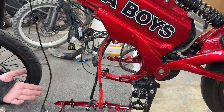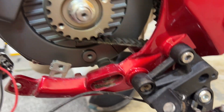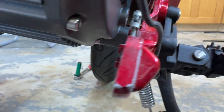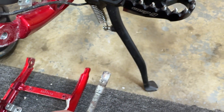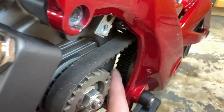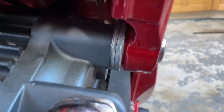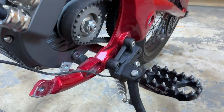The motor is in halfway. The left side has both screws in tight; the right side has none yet. We used washers to fill the gap on the top mount and got the screw in. Looking at the bottom, there's still a gap — the original bottom spacer doesn't fit anymore, so we're going to have to grind it down to maintain proper belt tension. We're also very close to the rear driveshaft sprocket, so we'll put a shim on there to move it away from the motor.